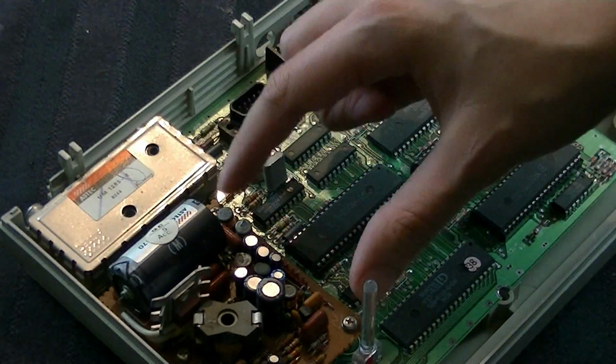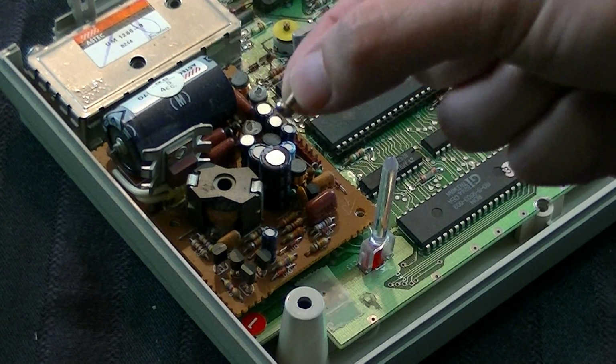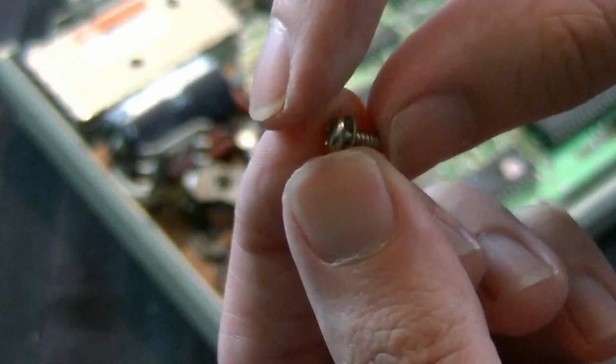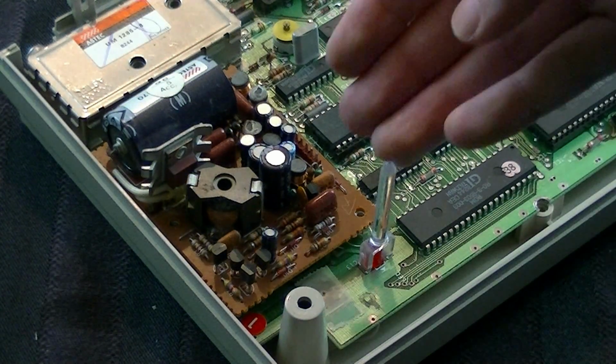And you'll see here there's a power supply that appears to have 3 screws on it. 2 right here and 1 right back there. It's a small silver one. Word of warning to everybody, these screws that come out of the power supply here have these tiny little washers on them. I'm sorry about the autofocus. You see that? It's a tiny little washer. Every single one of them has it, so just make sure not to lose that. But now let's focus back on here.